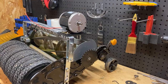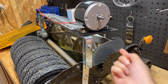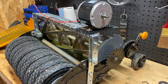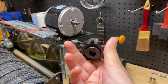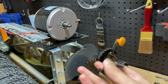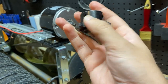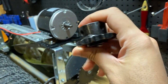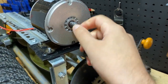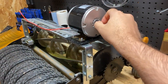Here's the motor already on the mower. I did have to take the cover off to be able to bolt the screws from underneath — that made the job a lot easier. This is the sprocket I'm going to be putting on the motor. It attaches to the shaft with two bolts, so it's basically held with friction. As you can see, this shaft doesn't have any keyed entry, so it just adheres there with friction.